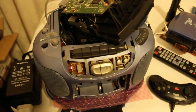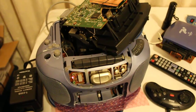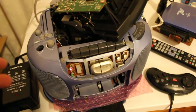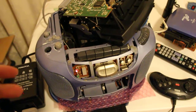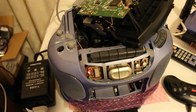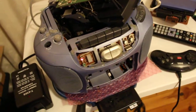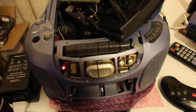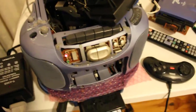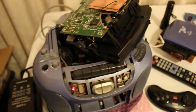I suspect the transformer is at fault, which is going to be a pain. So I guess my next step in the grand scheme of things is to pull the voltages that this transformer in here is outputting, then build some sort of external power supply to replace the busted one — and then fingers crossed it'll work just as well. It might not, but there's not much left to lose. Thanks for watching — retro junkie dot net for more or the latest updates.